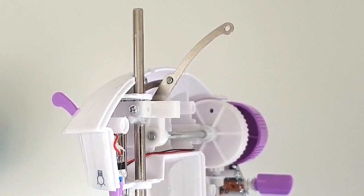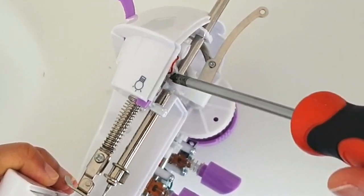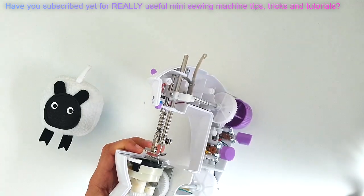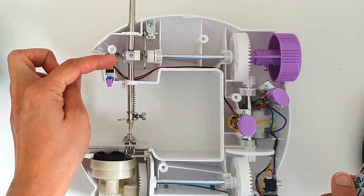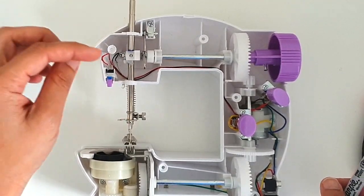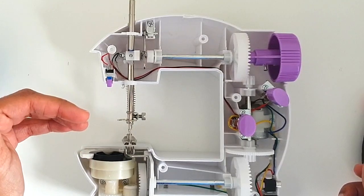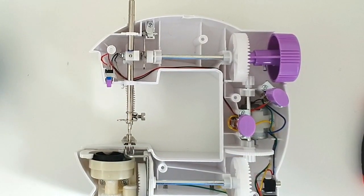So let me try to destroy the machine and show you how that might be. I'm going to loosen this screw deliberately. It's important to remember that this white thing and the screw is grabbing the shaft at a certain position. It shouldn't be higher or lower than that position, because otherwise the needle is either going to dip too deep into the bobbin casing or not deep enough. So using a sharpie, I'm going to mark out where it's grabbing the shaft.